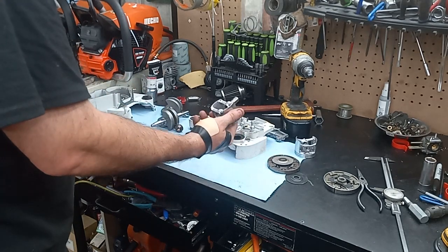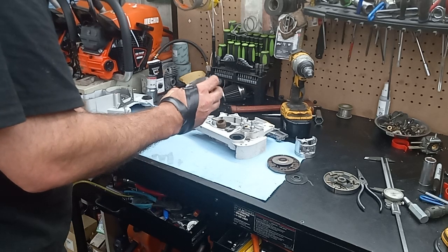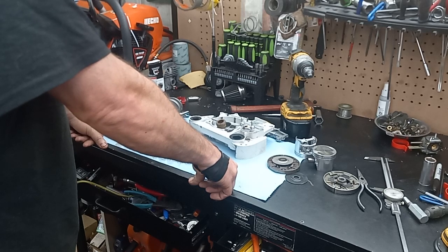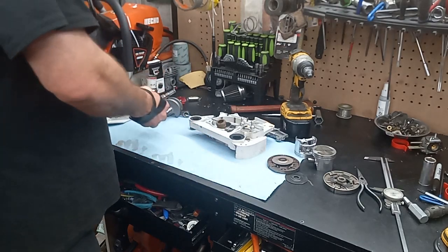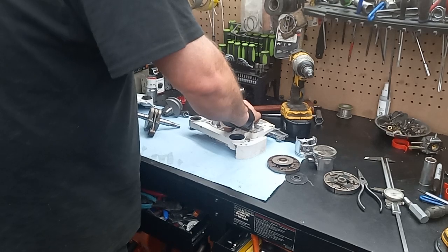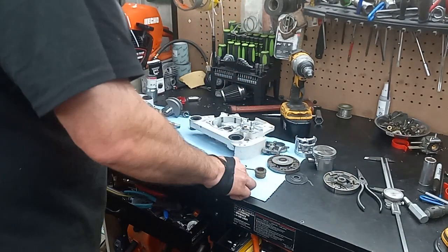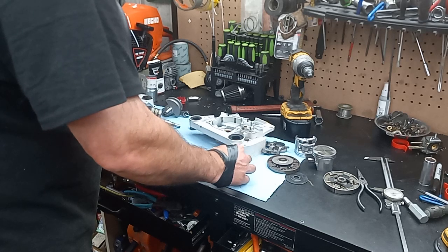But I don't know if I'm going to try to use this piston or if I'll buy a highway piston. Not sure yet. Haven't crossed that bridge. But my first step is get the big bore kit coming and gasket kit. That way I can get this assembled and start lining up and working on the clutch and oil pump. But if not, another option I was thinking is maybe use the 661 worm gear and then machine out the oil pump to fit it.